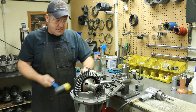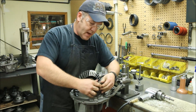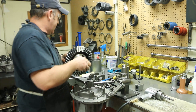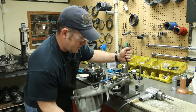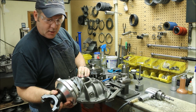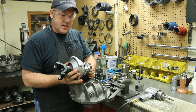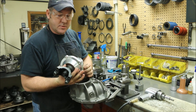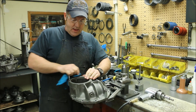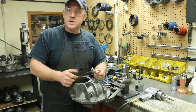If you do a little bump, it'll come off pretty easy. Sometimes spanners will come off with them — if they do, great; if not, you can take them off. Spanners can go from side to side, but I tend to keep them with the original caps. Then you can lift out the carrier. There is an O-ring in it, so sometimes it'll take a little bit to get it out. Some people will silicone them — I'm not a big fan of that. If it's leaking around your pinion, replace the O-ring, because that's usually the problem. The OE stuff, the older stuff, with time they get really dry, brittle, they crack. They used a D-shaped O-ring for a while — I'm not a big fan of it. I always replace the O-rings and seals on anything I do. Pretty simple, pretty cheap — it's good insurance.